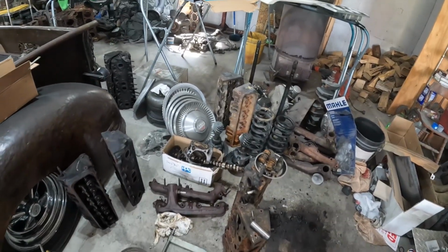But if that works out perfect. I'm not able to use my stock cam. It's got some pitting on it, and I don't feel comfortable using it, as I don't want to drive it 30, 40 miles and have to put a new cam in it, or new lifters and a new cam because a pitted cam wiped something. So the cam's just gonna be decoration. Who knows, we might make something out of it. We'll find out later.